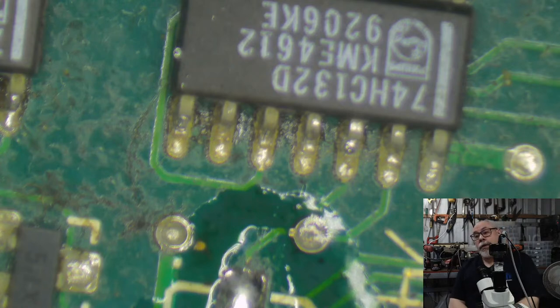unless I haven't cleaned the water in the ultrasonic cleaner for a while. So the whole thing is what is leaving the residue, what's actually causing that residue to end up on there. So it's either that the isopropyl alcohol is not pure, it has something else in it, some sort of cleaning solution or something like that, because things like rubbing alcohol might only be like 70% alcohol, and then the rest is other things in there. So what's being left behind, the residue, is something.